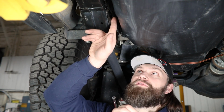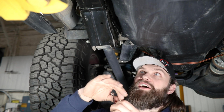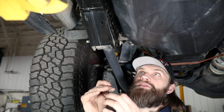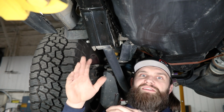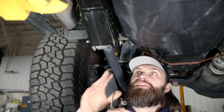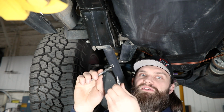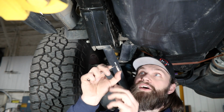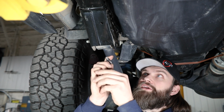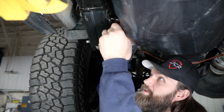So then up here on the front one, it's still just a little bit too tight to get that Torx socket in there with the ratchet. So I could move up front, loosen up the front half of the tank skid just a little bit and try and manipulate this tank a little bit further. But something you can also do is find a 1/4 inch wrench, slide that over the bit side of your socket, and that should allow me to get this up in here and be able to use the wrench to turn this socket.